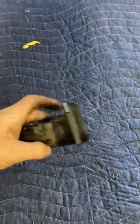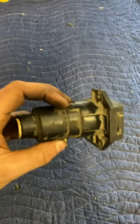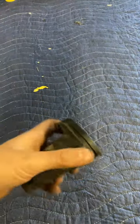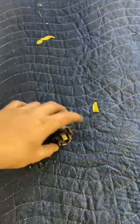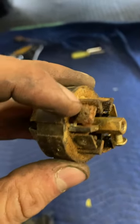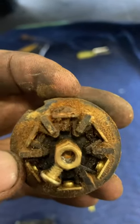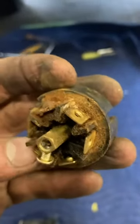I'll show you what I'm talking about. There's a screw here and a screw here. You pull these two screws out and with the wires you have to push the wires through the back, and everything pops out — the whole guts pop out the front side. On the terminal — this is the terminal for the brake controller for the trailer brakes — it is so badly corroded, the wire was snapped right off. And that's what the inside looked like.